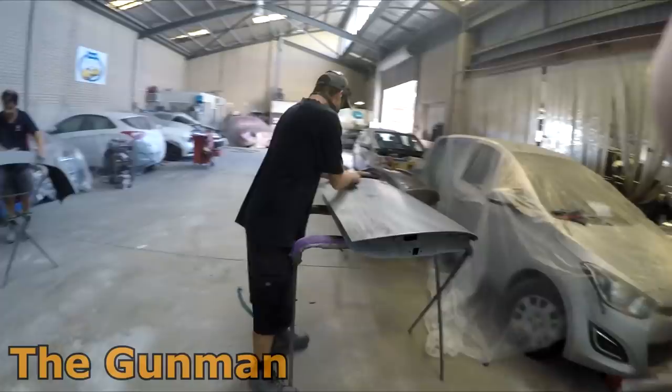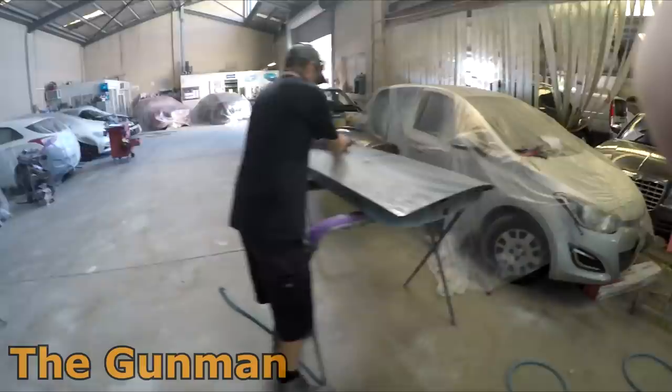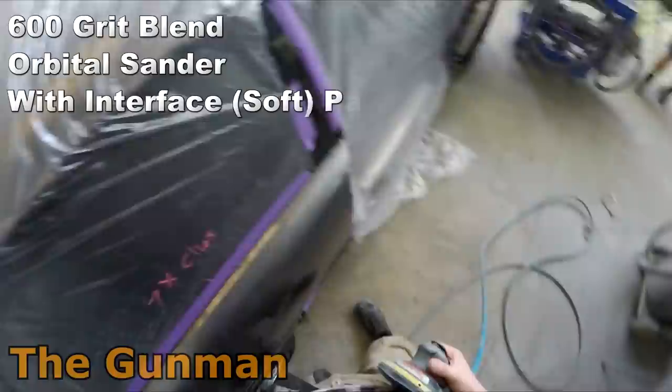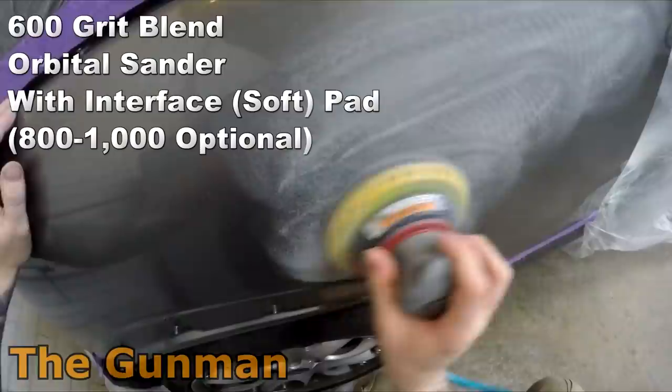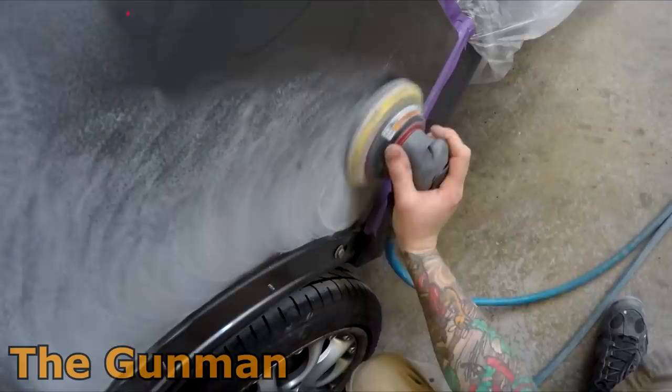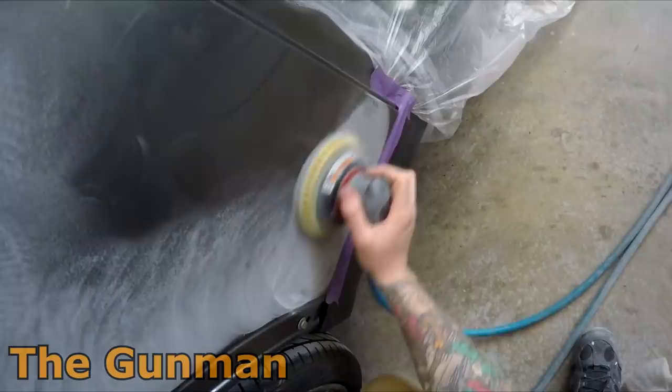Here I've got AJ or Alan Jones sanding down the secondhand door. There were a few repairs on it and we've primed the entire exterior of that door, and Alan's giving it a good block down with the long block. Basically what happens a lot these days is Alan will prep up my bolt-on panels, I'll go and do the blends and color matching, and by that time we meet each other halfway — those bolt-on panels are ready to go in the booth.